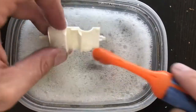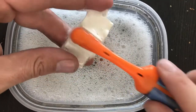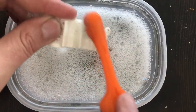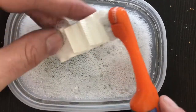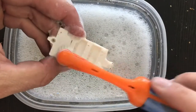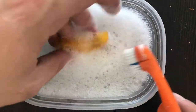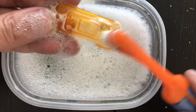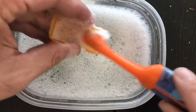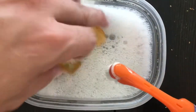The first step in restoring any of the plastics is just to get everything clean. I like to use a little soapy water — nothing fancy, just a little Dawn dish soap in some warm water. I really like using Dawn because it's got the grease cutter agent in it, and a lot of the dirt and grime that gets built up in these things tends to come off really well with that grease cutter. It's cheap and it seems to work better than most of the other things I've tried. Once I get all the plastics cleaned up, I'll be able to see just how scratched up some of these windscreens are and what exactly I'm going to have to do to try to get them restored.